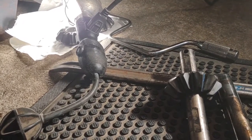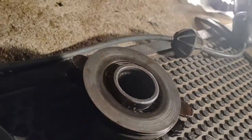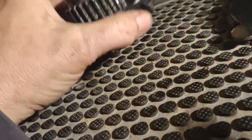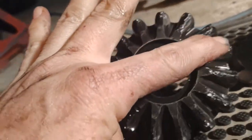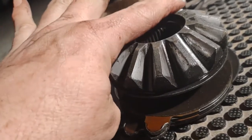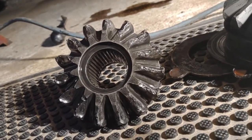The clutch packs are the same — yeah, clutch packs are the same. I'm sorry about laying on my belly here. Let's count teeth. This one here: one, two, three, four, five, six, seven, eight, nine, ten, eleven, twelve, thirteen, fourteen, fifteen, sixteen. And this one: one, two, three, four, five, six, seven, eight, nine, ten, eleven, twelve, thirteen, fourteen. Different diameter — that's why the shaft and the carrier are different.